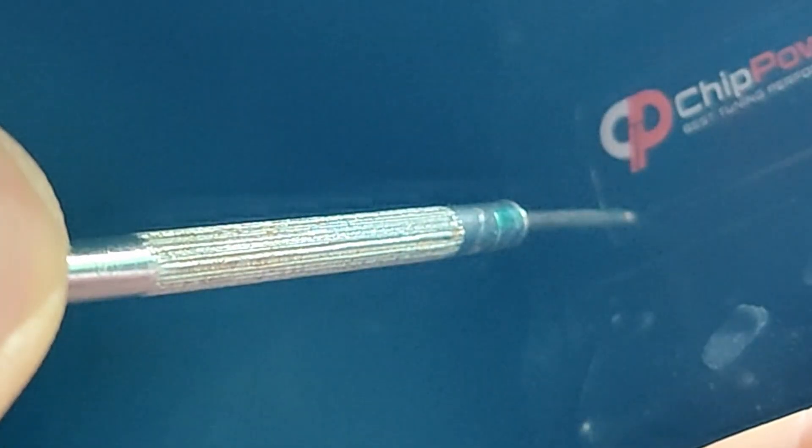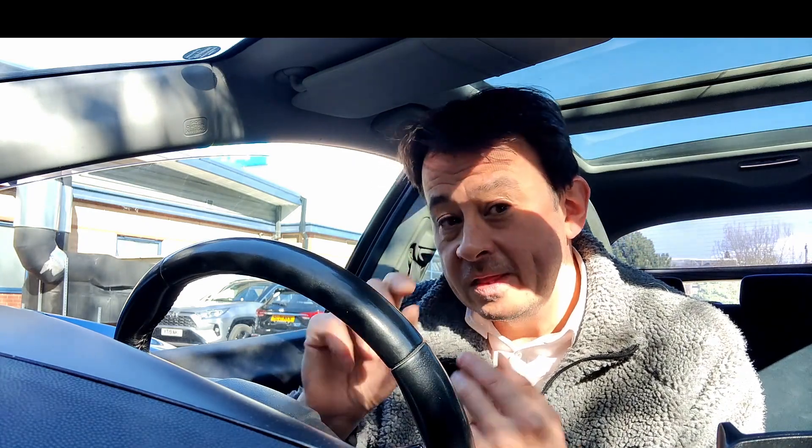Five and that's six. So we've got six turns. Now, the manufacturer says the unit is designed so that if you keep turning and forget how many turns you've done, it automatically reaches the end — but it won't stop. There's a prominent click, and when you feel that click on the screwdriver, you know you've just gone back to the start. So if in doubt, keep turning until you feel that click, then start again with another six turns and so on.